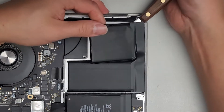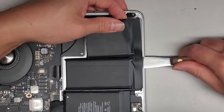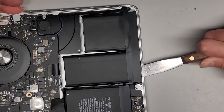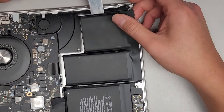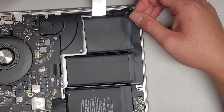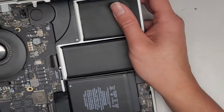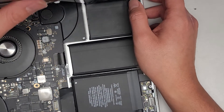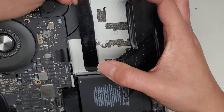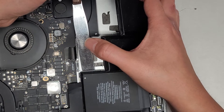Going at an angle this time. I'm going to rotate the tool over this way and get underneath here. When you cut this, you actually want to be pushing the tool straight in — you don't want to try and slice it sideways. Usually when I move it sideways I'm just checking to make sure I cut all the adhesive, but if it gets stuck, pull the tool back and push it straight. These middle ones are raised a little bit because of the track pad, so you do have to lift it slightly higher, otherwise you'll just hit the track pad.